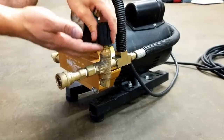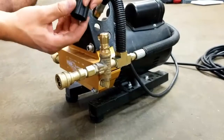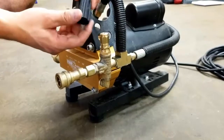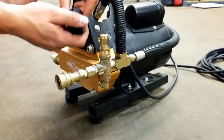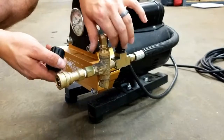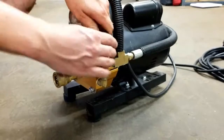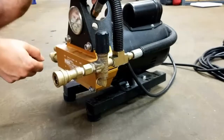So the fix is fairly easy — pop the cap back off. Sometimes it's on there pretty good. You can see I've actually got some tool marks on mine from when I had to pull mine off when this happened a couple months back. Pop this off, raise this lock nut back up, let it float, and then put the cap on and turn it to increase the pressure.